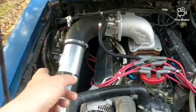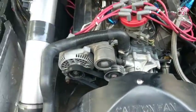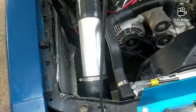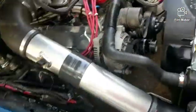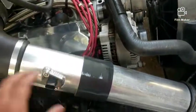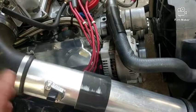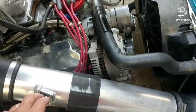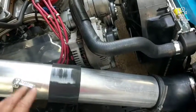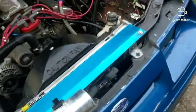I got my mass air meter working right with a little screen in it, and it seems to run better at wide open throttle — still a little flaky at part throttle, but it works. I run a boom tube so I don't have to mess with the air box anymore. That ran a 7.19 at 94.5 with mass air.